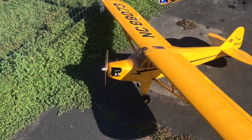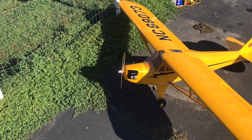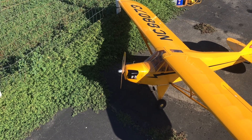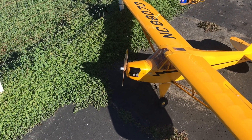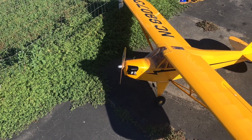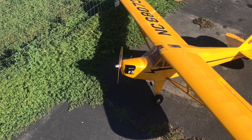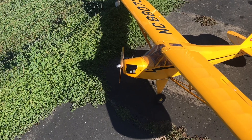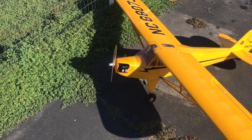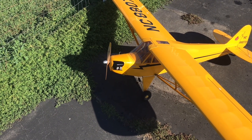So what I'm about to show you is a little test. That last flight I ran it down to what I think is a little less than a quarter of a tank. Hopefully I can get the video and shots looking through the canopy. What I decided to do: I started it up, put it at about half throttle, and tested the felt clunk to see if it would stall out. I turned the plane basically vertical — straight up — then turned it straight down and let it sit there, and what you'll see in the video is that it didn't stall out.